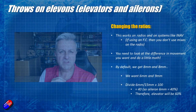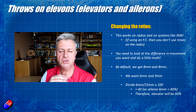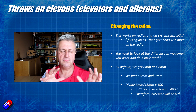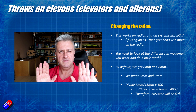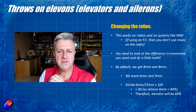If you know the throws that you want, you can work out what the ratio needs to be. It should never exceed 100%. It also works in conjunction with the physical linkages on the wing to give you the throws you want. New pilots often think only about the mixing on the radio or in iNav without considering the actual physical linkages on the control surface. But let's set those aside for a moment and focus on the first step: what should that ratio be? Is 60-40 right? Is 70-30 right?